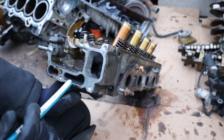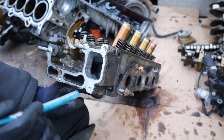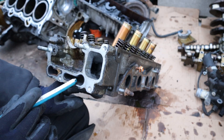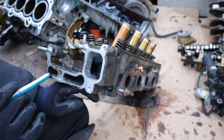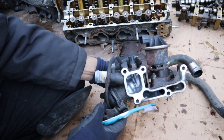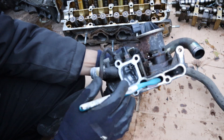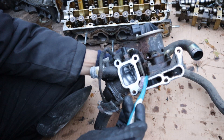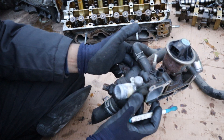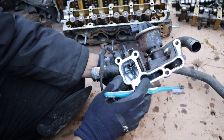The other feature of this engine head is the EGR system. Here you can see we've got the exhaust side of the engine — part of that exhaust is going to be sent out through this little hole where the EGR system bolts up to it. Here's where the EGR comes out, here's where the exhaust gases come out, and then here's where it goes back into the intake side. This is the EGR valve, which is a common issue with almost all Hondas because they tend to clog up and cause drivability issues or engine surging. The point of the EGR system is to recirculate some of the exhaust gases to help with pollution and emissions. By having that hot exhaust gas attached to this cooling jacket, it helps cool those exhaust gases as they go back into the intake system for better combustion.